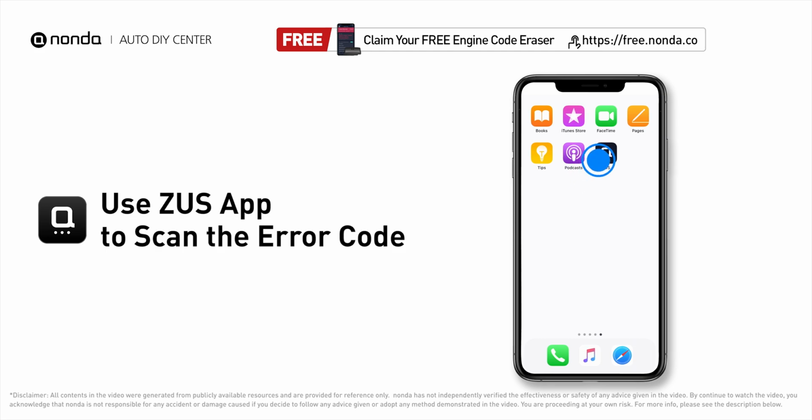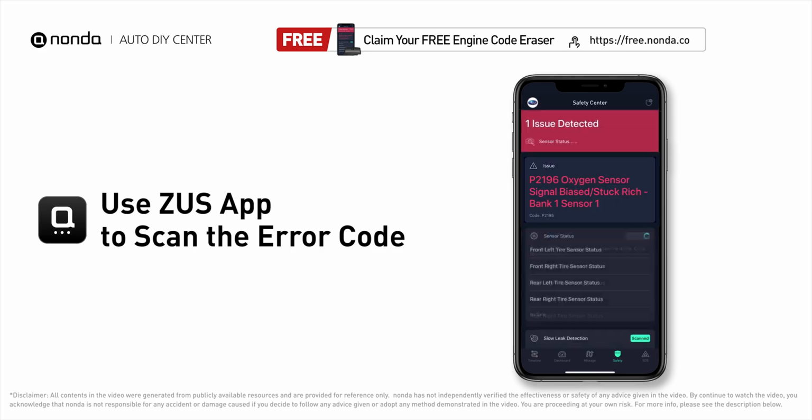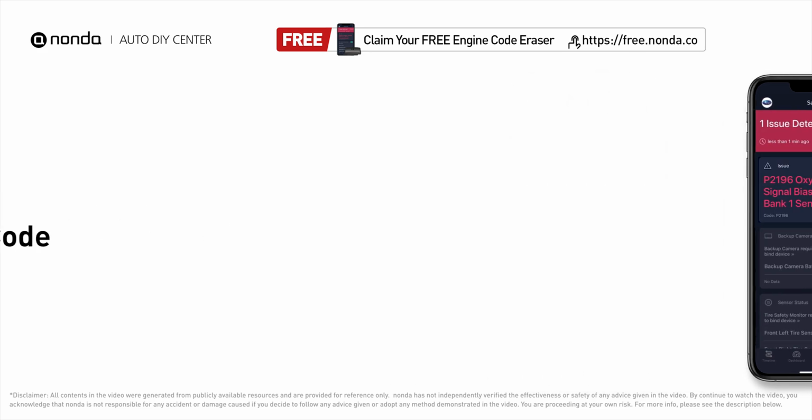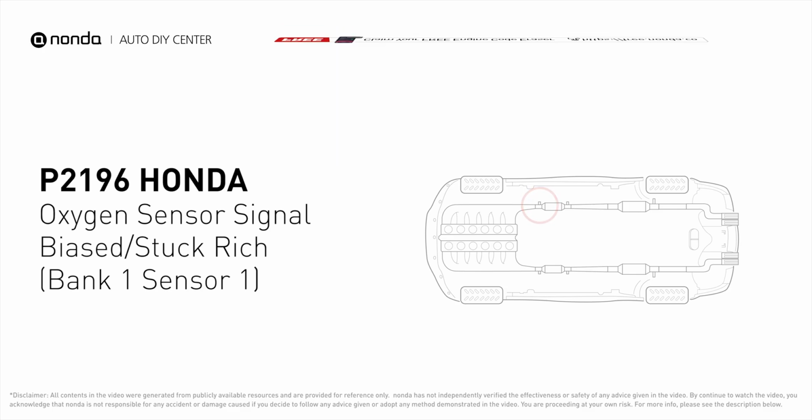Use the Zeus app to scan your vehicle and see the error code P2196. It indicates that there is too much fuel in relation to the oxygen in your vehicle, or that the oxygen sensor is faulty and reading an incorrect air-fuel ratio.